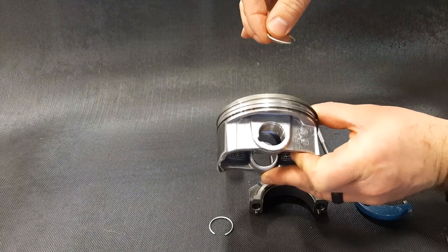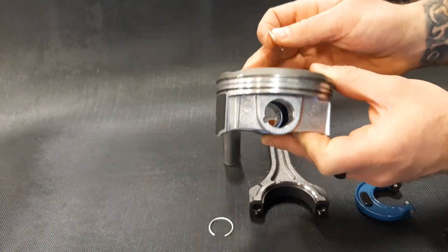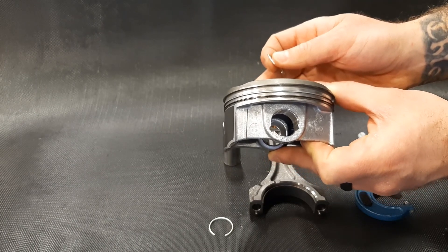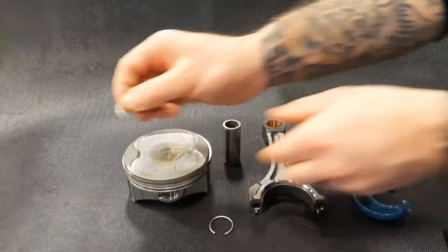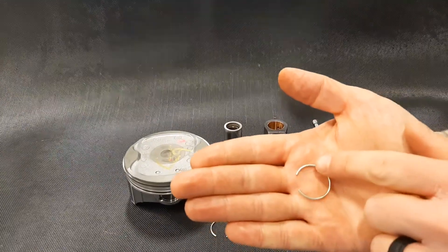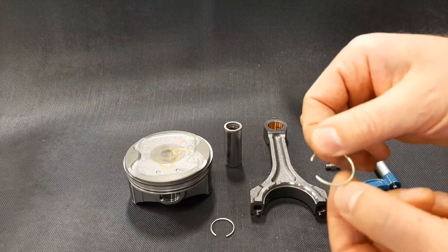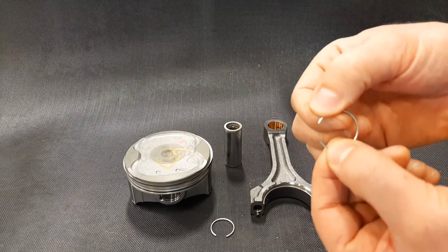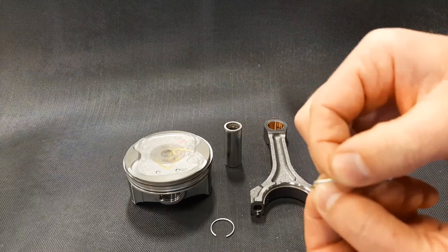Now, it doesn't look like that would be a big deal with this sitting static on the bench. However, remember that at high RPM, this thing is moving between bottom dead center and top dead center at 5, 6, maybe even 7,000 RPM or higher with a race engine. The problem is inertia. Even though that snap ring isn't very substantial, at 7,000 RPM the top or bottom of it will essentially become heavy enough to collapse itself. So if you leave the gap sideways, the top or bottom collapses moving up and down in the cylinder, and eventually you're going to hit it right and that snap ring is going to pop out.